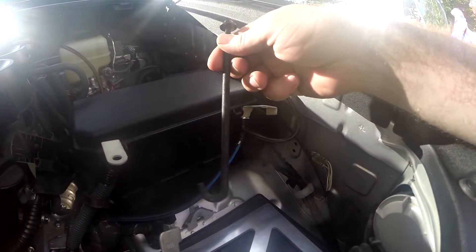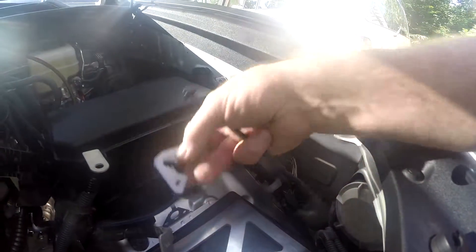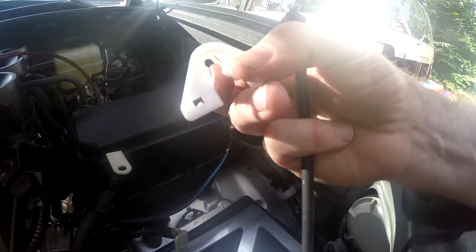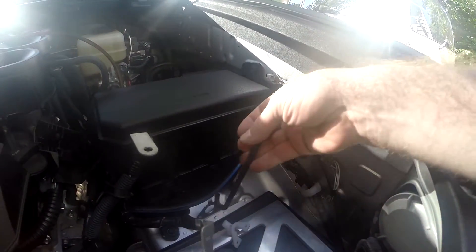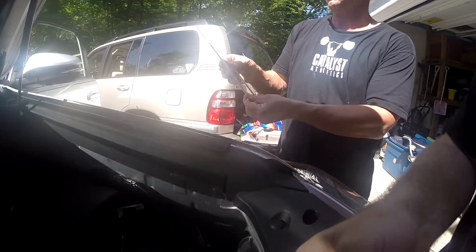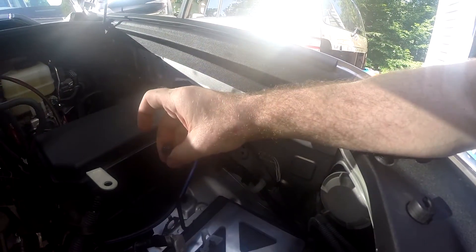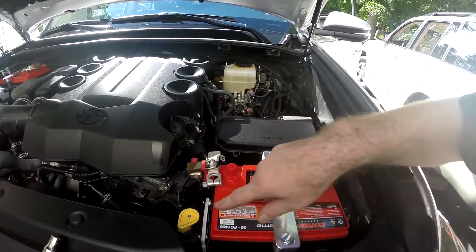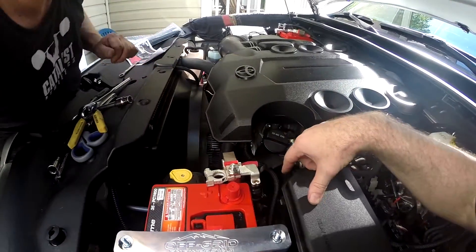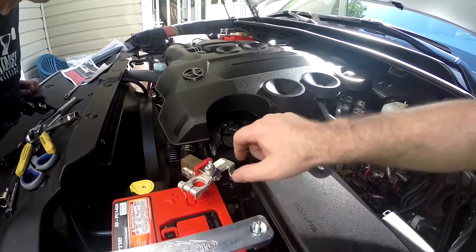This is the stock battery J-hook. At first we thought we needed to take the plastic bracket out, but you can see this bracket has two little tabs that keep the J-hook from falling down in there, so we just pushed those tabs in and were able to push the J-hook down to get it out. The kit comes with a longer J-hook — once you have the platform in and the bracket sitting a little higher, the original isn't going to reach. We got the main battery tied down and double-checked the wire routing. We're going to mount this at an angle so the heavy wire can come around without too hard of a bend.